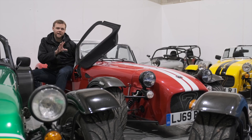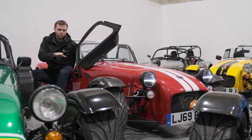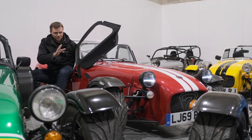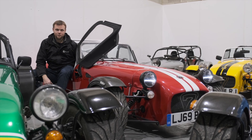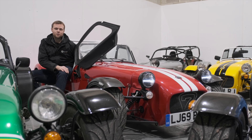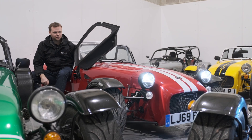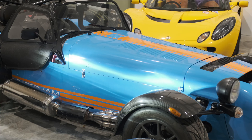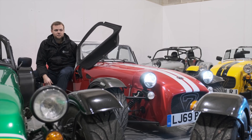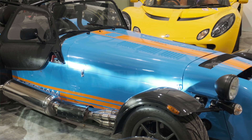These are Caterham's official LED headlights. Instead of having side lights, they're replaced with a horizontal bar known as a DRL, or daylight running light. These are extremely helpful to us as drivers in ensuring that we're seen — they are a much more visible cue for other drivers than the dim glow we get from standard side lights. Moving to full dip beam, you can see we have a huge amount more light. When you toggle them to high beams, they switch off the dip beam and translate into a high-powered long channel of light.